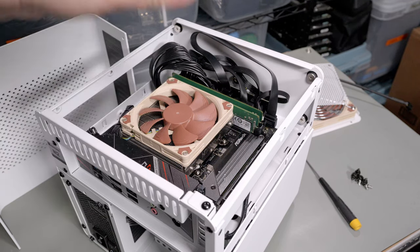The way I got extra SATA connectors is that I replaced the onboard Wi-Fi card in the hidden M.2 slot — I put in a little M.2 E-key to dual SATA adapter board and just installed that. That's why there are no antenna connectors on the back of the motherboard.